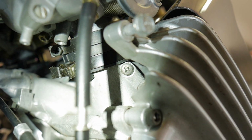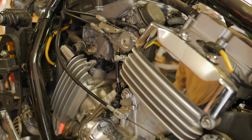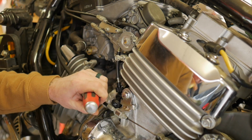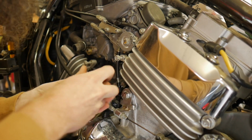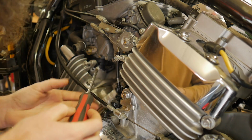And for this bike, the ports that we are accessing are those Phillips head screws. You see they're kind of hidden behind these covers, which can be removed. You can take these covers off, and they are on all 4 of the intakes. And for this right side, we know where one is right here, or that vacuum line for the vacuum operated fuel valve. We can follow that one back to its port, and then we'll have to kind of sneak in here and grab this one right here. So we can grab a JIS style screwdriver number 2, set it up on there and give it a couple hits, and it should break loose just like that. They typically have some type of aluminum washer behind them. Try not to lose your screw taking it out. Magnetic tip helps.